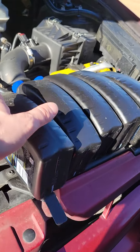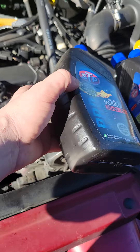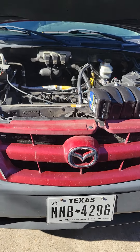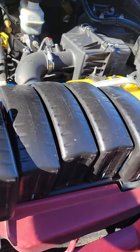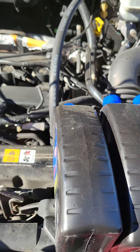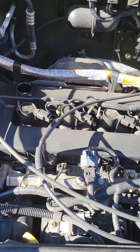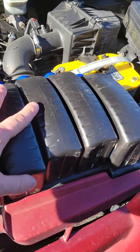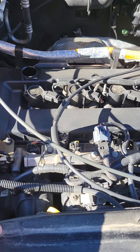Changing your oil is very simple. First you need to know how much oil you need and what type. This is my farm car, my Mazda Tribute — it's what I run around in, bring my animals around. This requires four and a half quarts, so I put five up here. Four and a half quarts of oil, 5w20.